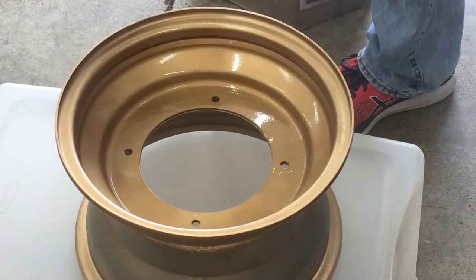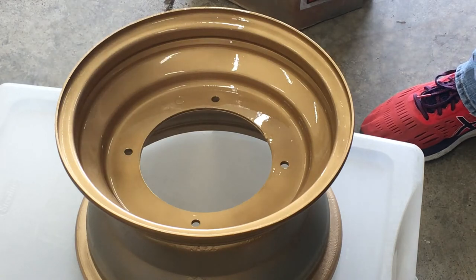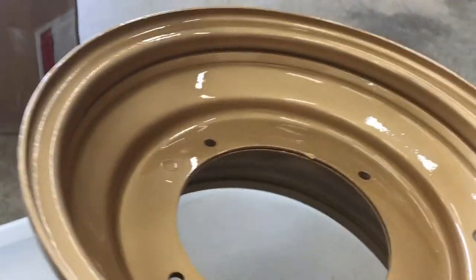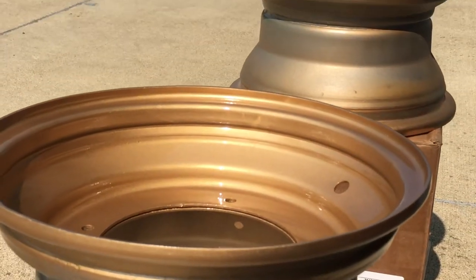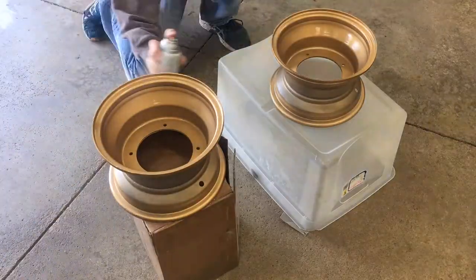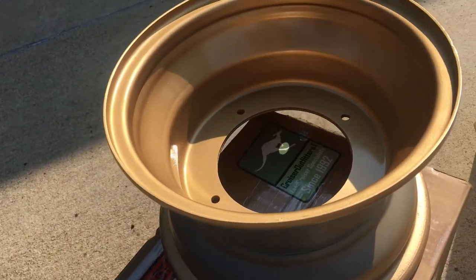The ideal wet coat is go heavy, but not heavy enough to cause any runs or sags. It's kind of a gamble to get that glossy self-leveling finish — go too heavy and you end up with a nasty run. I've learned when to quit spraying over the years, and this looks perfect. I'll just do the bead area now. I'm happy with that — nice and glossy. I brought them out in the sun to dry, I'm loving the gold. That gloss over the gold really adds depth to the metallic. After the clear cured, I went back and did two light coats and then one wet coat of clear on the backsides of the rims. They're a little harder to paint because they're deeper, but I'm happy with these too. Not quite as smooth as the front sides, but I won't see the backs anyways.